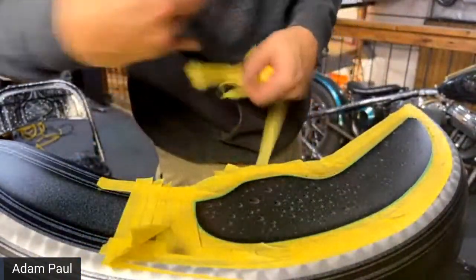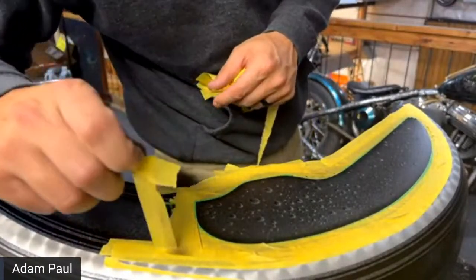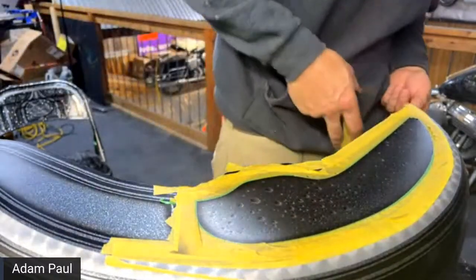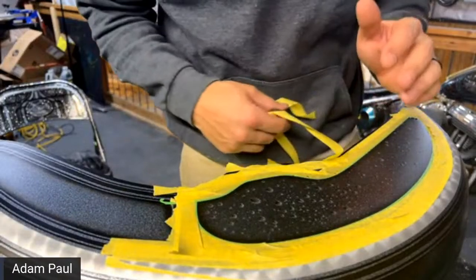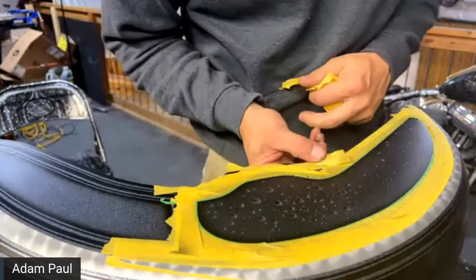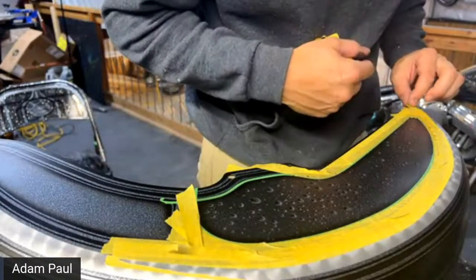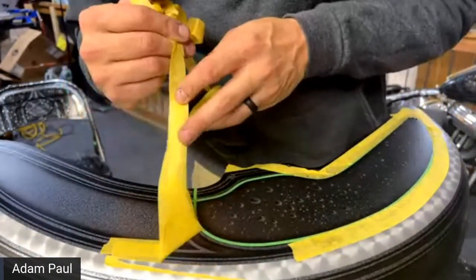Clean it up really good. Make sure you got wax and grease remover on there. But yeah, keep those factory primers, man. A lot of people think they have to start the paint job by stripping all the paint off. But if you have factory Harley paint, you have primer on there that nobody but the factories can replicate. It's just too good of a primer. Don't strip it off. You just scuff it down and start with your new paint.